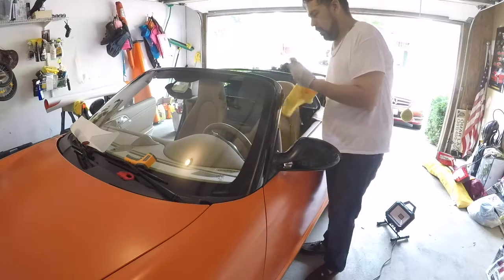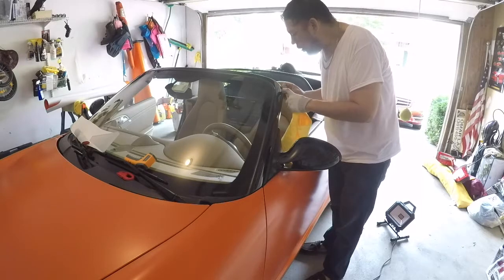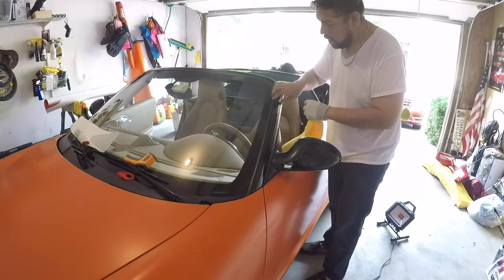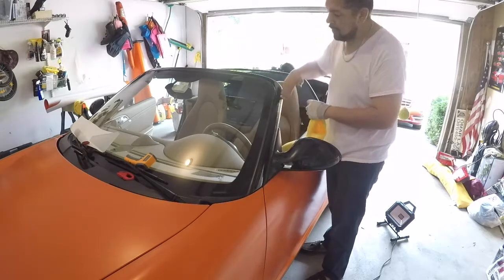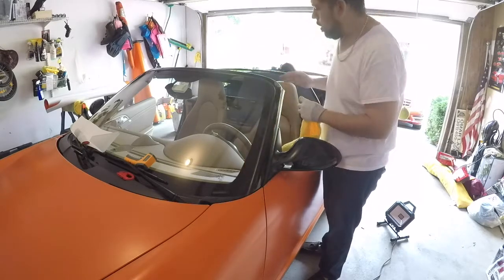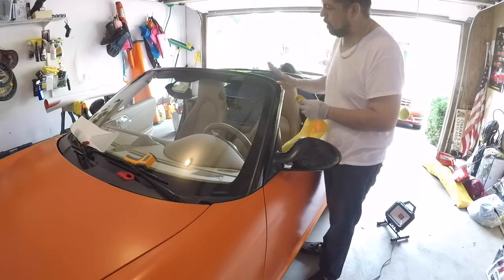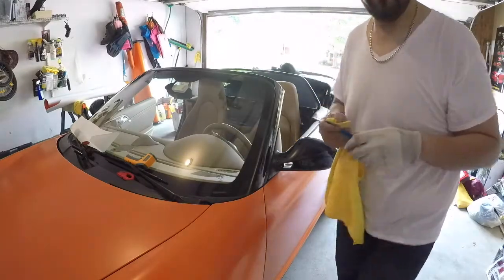And on this side, it's similar. You have to pull it out first. I usually use one squeegee to pull the rubber back and another squeegee to tuck in. So you'll see once I lay it there, I lay knifeless tape on this side to get a straight edge, knifeless tape on that side. I start at the bottom so I don't have to do any cutting, so I get a straight edge down there. Over there I lined the line with this black mark, so it's even on both sides. And eventually I go back and I'll tuck this. So I just wanted to explain that a little bit before I get started.